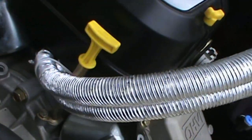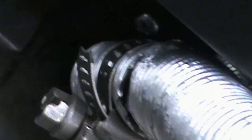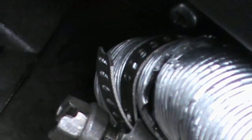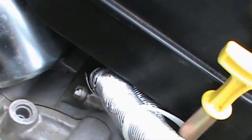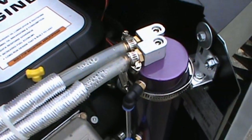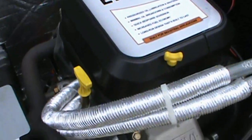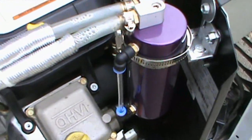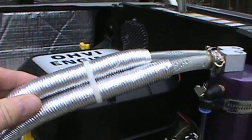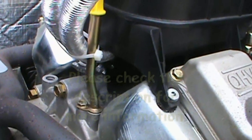And it seems to be working quite well. I took the original vacuum tube and simply pulled it loose from the little plastic tubing that goes into the carburetor, hooked it to a line with a little nipple, ran it into the sludge separator, took another line, brought it out, and ran it back up into the carburetor with an elbow. Then I went to an auto parts store and got this insulation and put it on these lines, because they do get pretty close to the top of this engine and a little heat can build up.